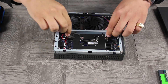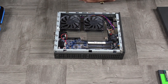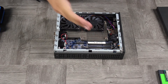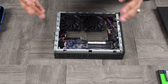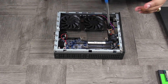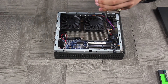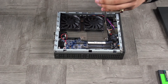Put the screw away and lift up the hard drive bracket — it's undone. Now, depending on your preference, you can install the memory first or undo the heat sink. I prefer undoing the heat sink so I have access to everything. All you do is undo these four spring-loaded screws. A good rule of thumb is to use opposite corners so the pressure is distributed evenly — this applies to both removing and installing the heat sink.